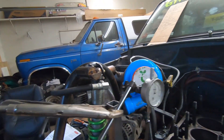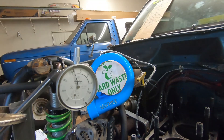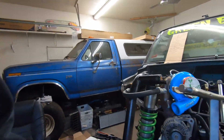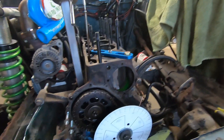This gauge we can't really trust - we got it for free, very wonky. But another thing is, you can move the gear a little bit and that's where the play is. Our theory is, if we replace our gears and timing chain with a factory set, because to me being off a thousandth or two is the play in the gear - it's not because of the degree of the camshaft. So our goal is get new gears, new chain, and run this test again. Hopefully, we are pretty confident that our cam is degreed properly.